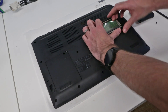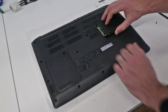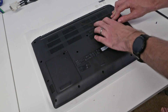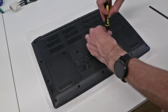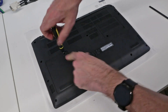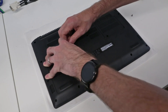This is actually a 2400 module. I have tested it and it works in dual channel with the 2666 module. The fastest memory this processor supports is 2400 anyway, so the 2666 module was running at 2400 anyway. We're going to use that to give us optimal graphics performance by having a dual channel memory configuration. Drop that screw back in.